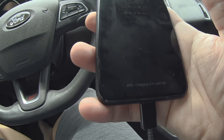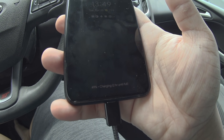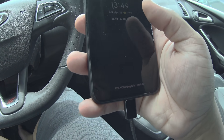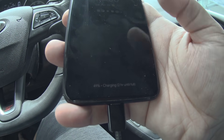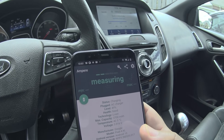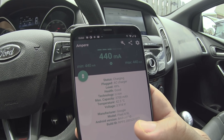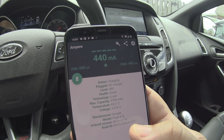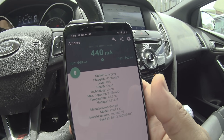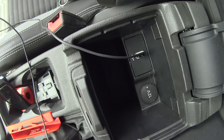Let's try the Pixel now. At the bottom the Pixel doesn't say charging slowly, it just says charging. I used to say charging slowly — I'm surprised it's not saying that at the moment. It's charging and it's two hours until full. Let's open up Ampere and get a reading. Right now we have a max of 440 milliamps. I later realized the Pixel was actually very warm, so that's why you see 440 milliamps. I did it again later off-camera and it was actually around 1050 milliamps max.